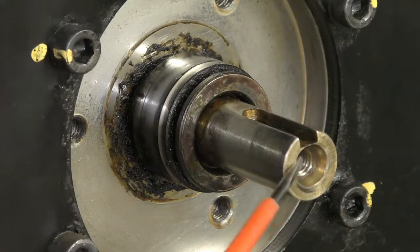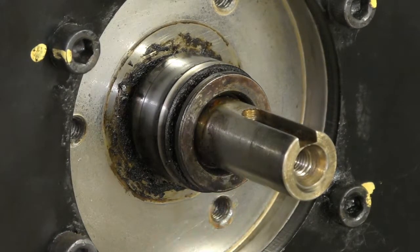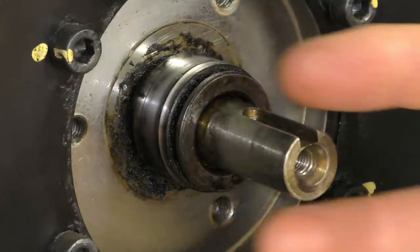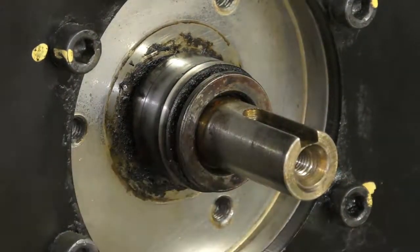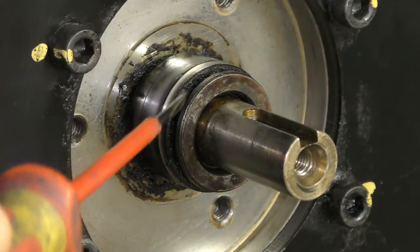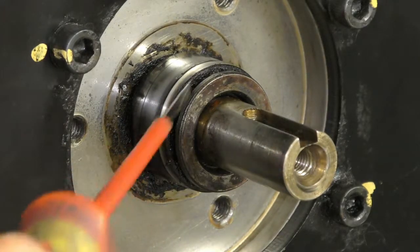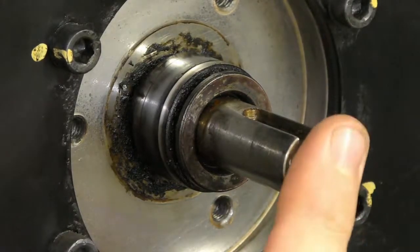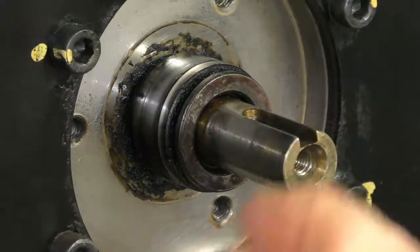What I'm going to do is make a puller — a two-piece puller. It's going to be split this way with bolts that come through. Two pieces with a lip sticking out to go in that groove. When it's on there it's going to be butted up against here, because I'm going to use the same tool to push the new one on.